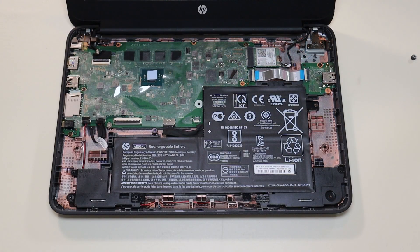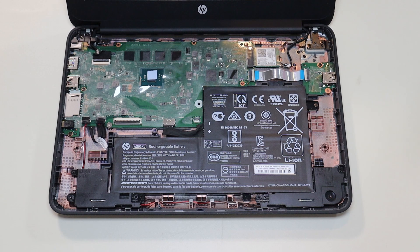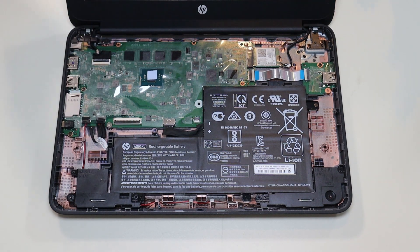As a general repair side note, whenever I'm working on a computer in my shop, I have it sitting on an anti-static mat. Either that or an anti-static bracelet are great ideas to avoid damaging anything in a computer. If you need any help with tools or supplies for your computer project, there'll be a link above and also below in the description with a list of the tools and supplies I use on this computer, as well as all the replacement parts for this specific model.